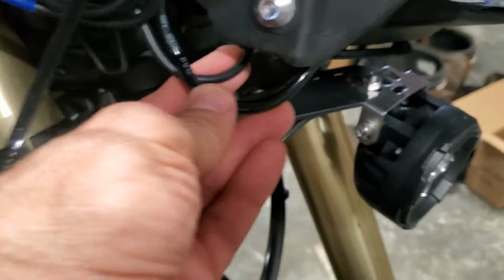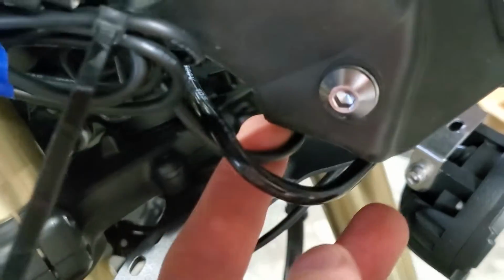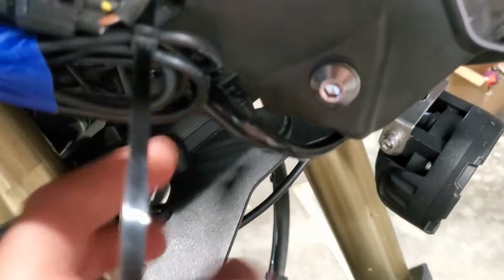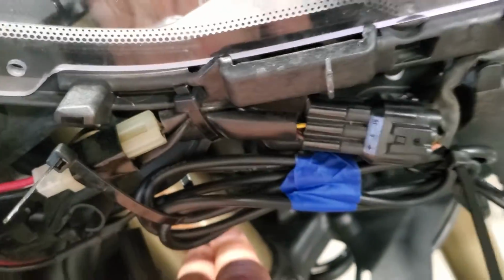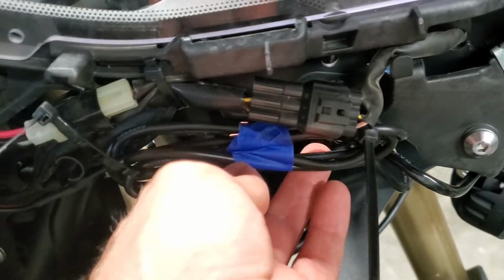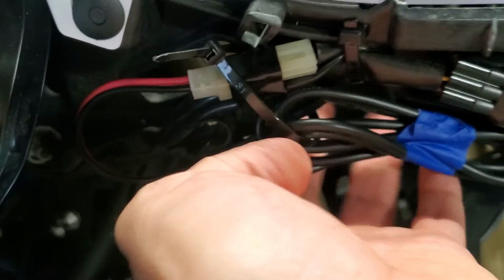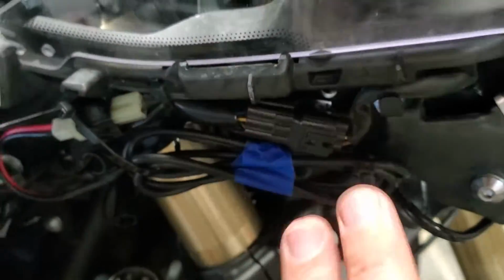And then I ran it out towards here, which I have this, it came with these lights, as you can see. So I had this wire here, and you'll see a little place to zip tie it to that panel in the end. So once I get this up, I will zip tie these two to the white panel, the fairing panel, to keep this from sweeping into or running into the forks when they sweep through here. Now I didn't want to cut the wire just because they had, for some reason, attached this lead on here. And so I just said, oh, there's probably enough room to hide this thing. Now, we'll probably run into the panel a little bit, so you want to make it as flush as possible. So these zip ties are semi-tight right now, and I'm going to tighten them up when I'm done, and they're nice and tight to the panel. And then the body panel should fit right over that when I'm done.